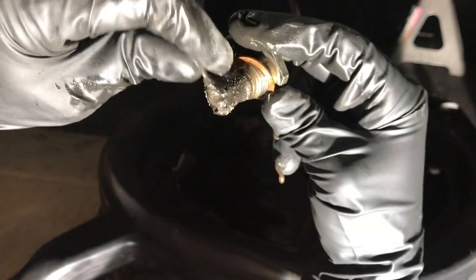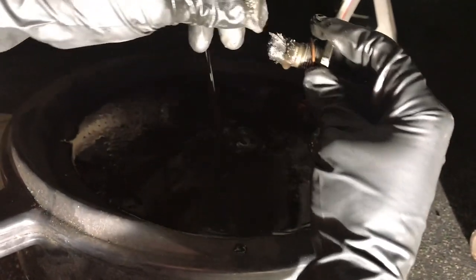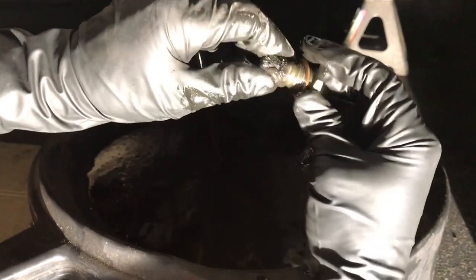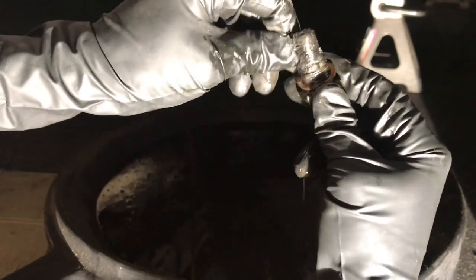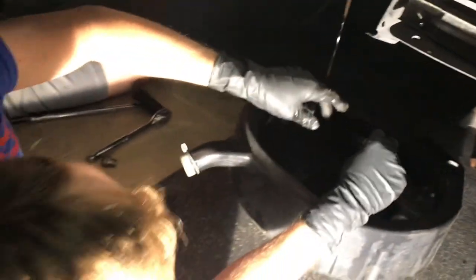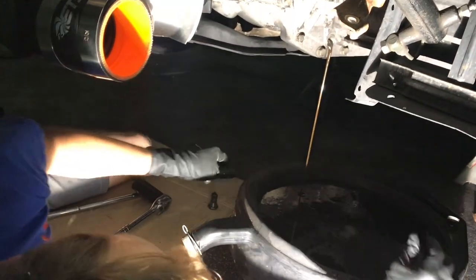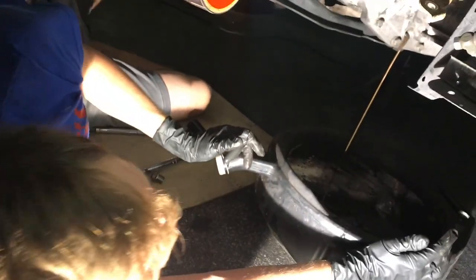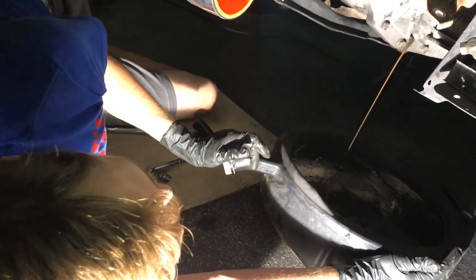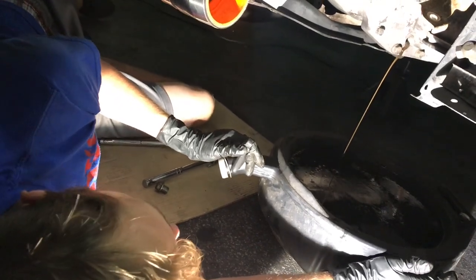Oh man, that's a lot of metal. Let's look in there - I'd say that's probably a good chunk of gear right there. He's flattened off the nose on third and fourth gear right there. So for the viewers, this car was having a third gear grind for a little bit, continued to drive, developed a third gear kick out and also a fourth gear kick out. So we're replacing it with the Bushwhacker stage 2 transmission.